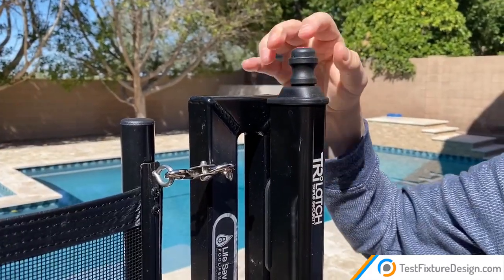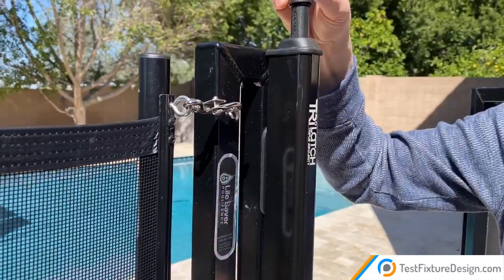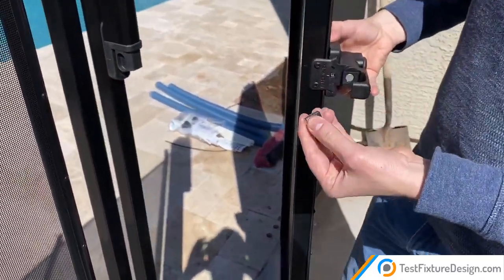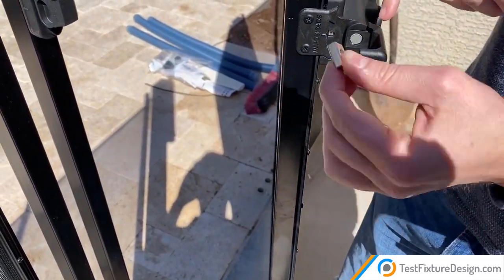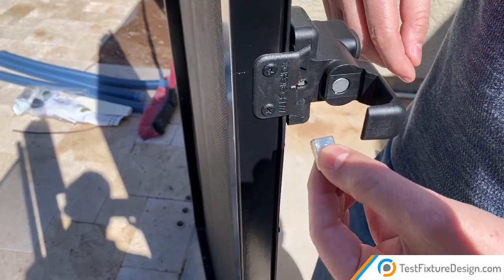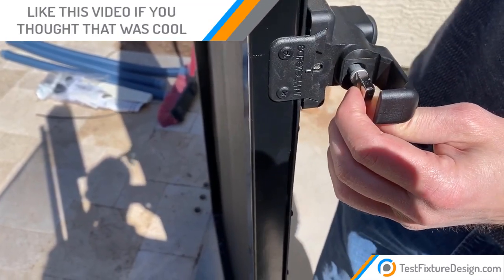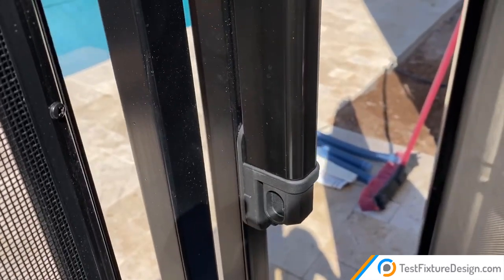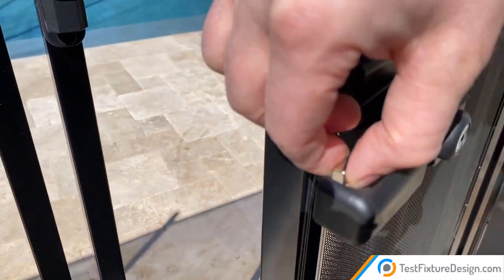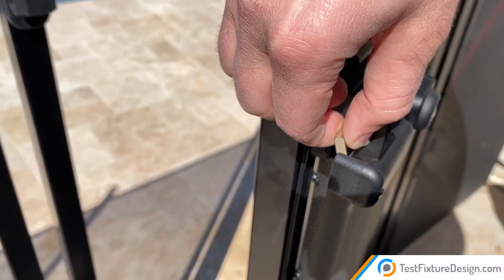I'm going to go grab a magnet. I'm not sure how the red button disengages it — there must be something down at the bottom because I don't see anything up at the top that changes. So here's a magnet, and in theory this magnet should work the same way that the one in the disconnect rod works. If we put this magnet next to the pin, the pin pulls out. So inside the shaft, what's happening is when the magnet moves up — we can simulate it here — my fingers represent that disconnect rod. When I pull it up, the pin goes back in, and when the magnet comes down, the pin gets pulled back out.